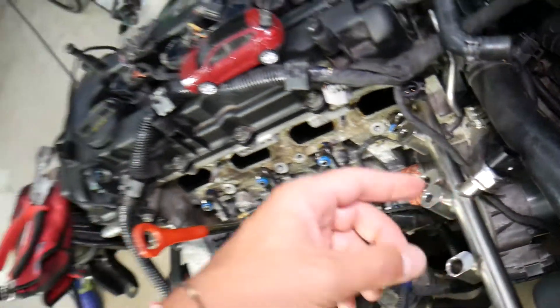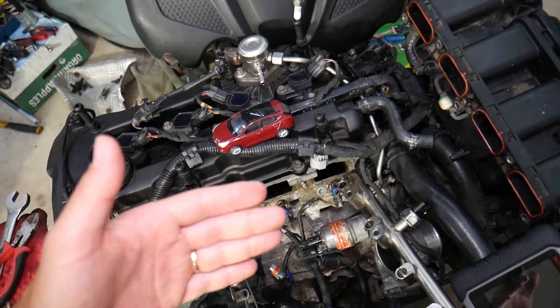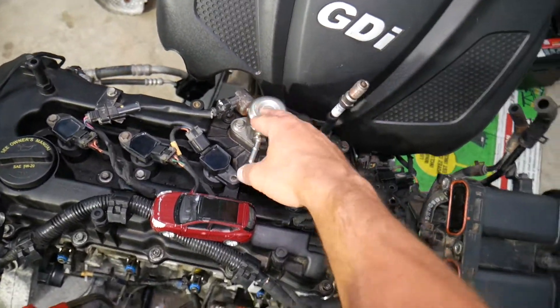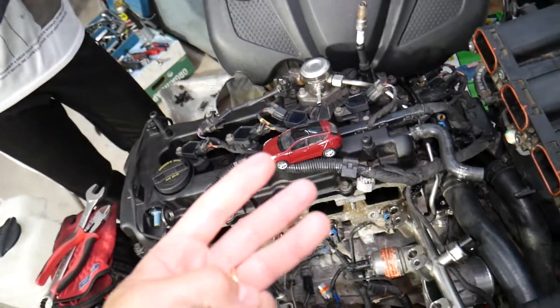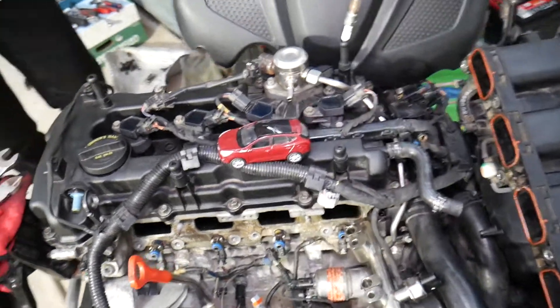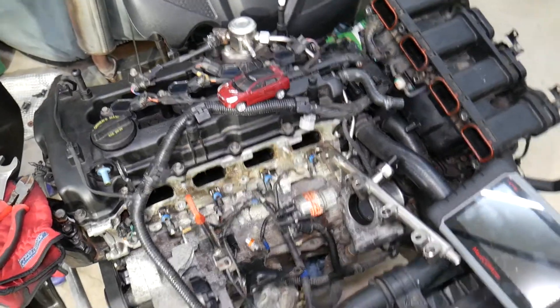Another cause is a weak low pressure fuel pump located in the fuel tank. That pump delivers fuel from the tank to the high pressure pump, which then increases the pressure to the fuel rail. So if you have a weak fuel pump, a failing sensor, or a dirty fuel filter, those are the most common causes we see here in the shop. Hopefully this video is helpful — thank you for watching, see you next time.